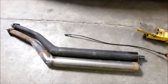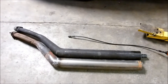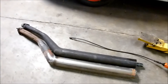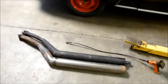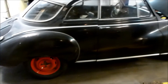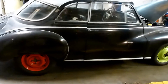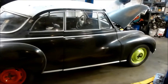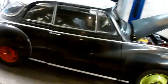This old two-stroke technology is kind of neat — it's a three-cylinder into one pipe, which is unusual. There's very little information on three-into-one setups; there's lots of information on single expansion chambers per cylinder. But there's not a lot of room under the hood of this car — it's got to fit through the suspension and under the body — so for now, three separate pipes are out, even though I'd love to have them.